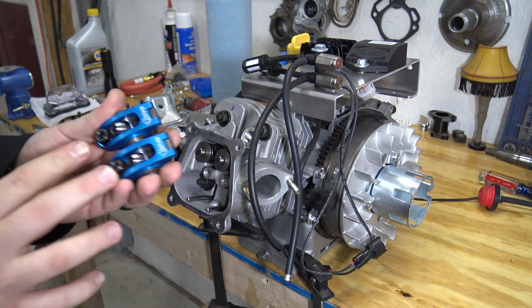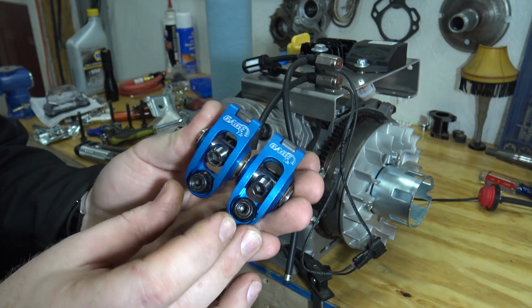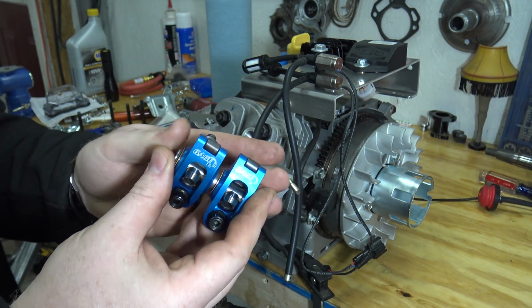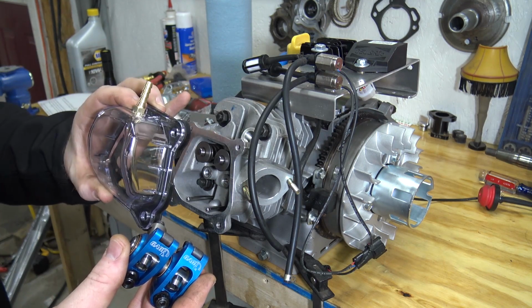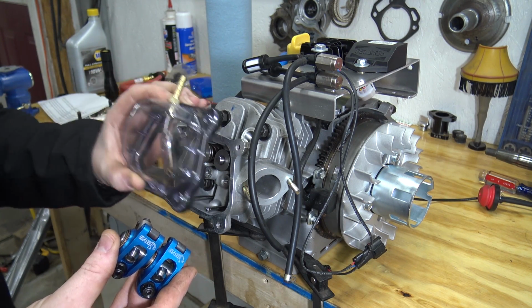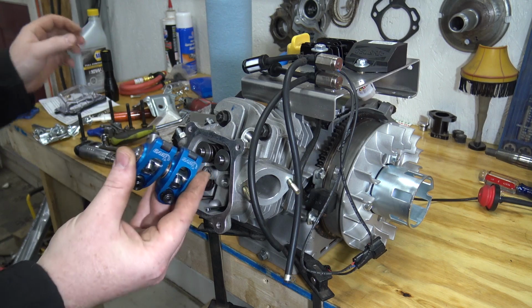Alright, instead of the black ones, we're going to go with the Ultralight gauge rockers from GoPowersports.com. The links to any parts used in this are in the description. If you're running a GoPowersports clear valve cover, you do not have to run the spacer. You only need the spacer with ratio rockers if you're running the stock valve cover. So this will give us plenty of clearance, and we'll be able to run those sweet rockers.